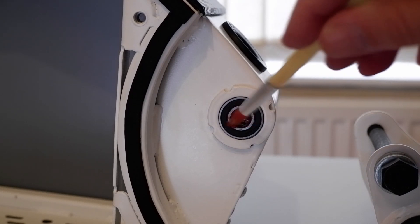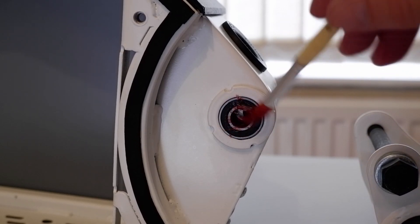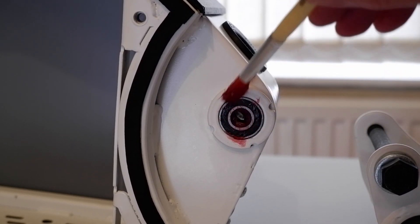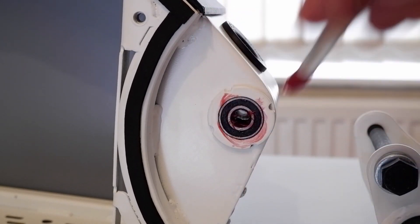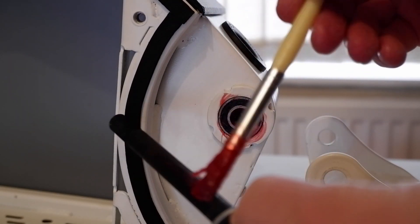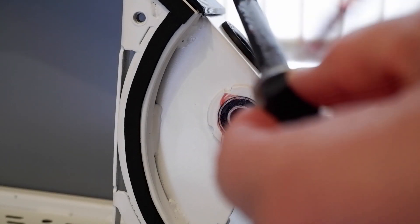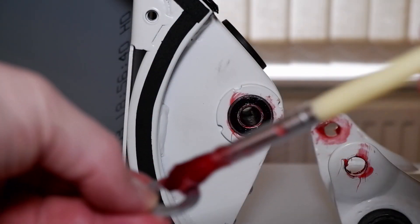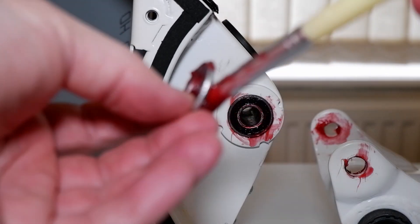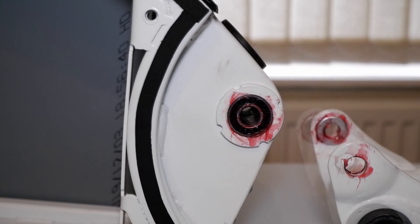So you can see that I like to add grease to everything - a bit of grease can't do any harm, can it? Unless you put it on your brake discs, then you're in trouble. So I'm adding grease to the swing arm bearings because I'm about to install the axle bolt on the swing arm. A bit more grease on the axle bolt - it comes with three washers. One goes on the end of the axle bolt with a nut, and the two go on the inside of the swing arm mounts. I put some grease on the swing arm mounts so I can stick the washers on there and slide it in. The washers should stay in place with the grease.